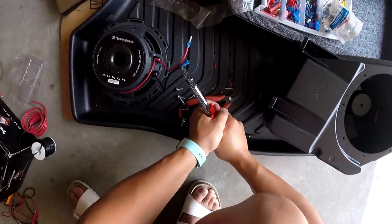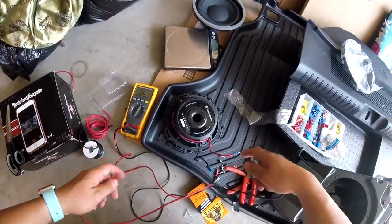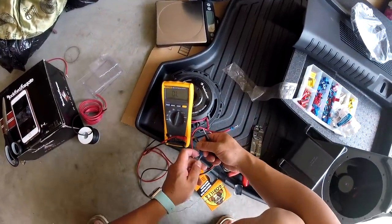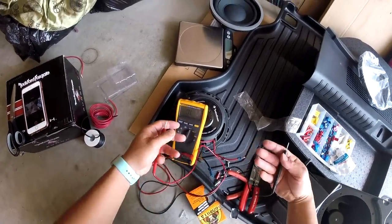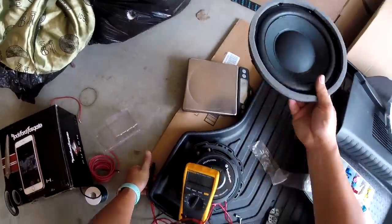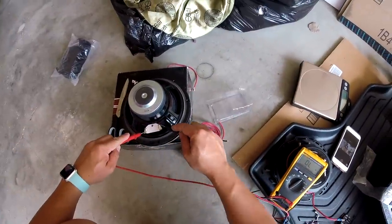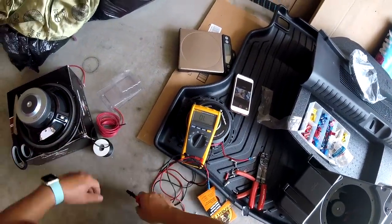Just to confirm that we've done our work properly and wired the sub to be a 2-ohm load, take your voltmeter and set it to the ohm scale. Touch the pigtail ends of our sub — it shows up as 1.7 ohms. There's going to be a little bit of variance because speakers have a nominal impedance, it's not necessarily fixed. So 1.7 is close enough to 2. We can confirm that by testing our stock sub, which shows 2.1 ohms. So we've got it correct.